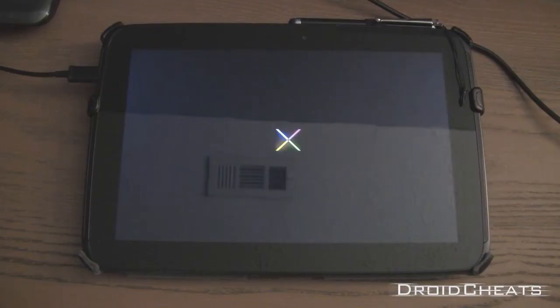system. Now if your device does boot loop, you wait a couple minutes. If it doesn't boot up after a couple minutes, it's probably in a boot loop. That's okay. I'm going to show you how to fix that. The Nexus Root Toolkit tries to fix it by sending you to the TWRP recovery to do a factory data reset, but that fails, as you saw.